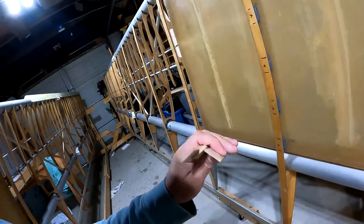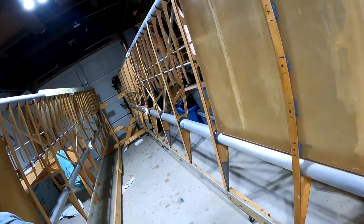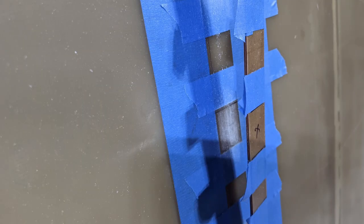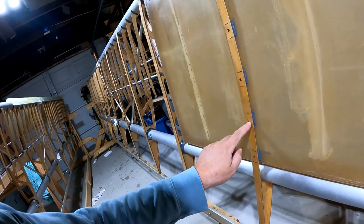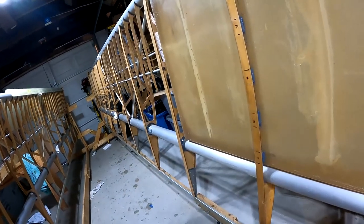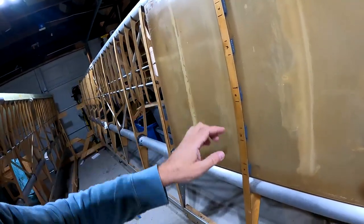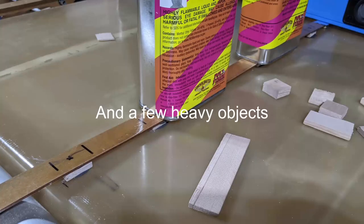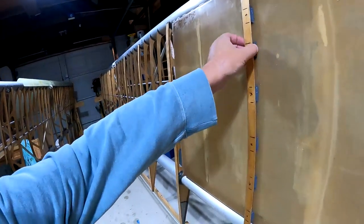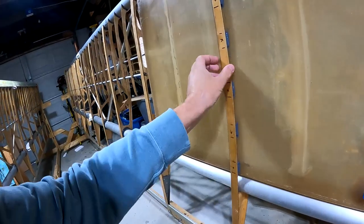I probably had a dozen or more shims in a random pile. Once I found a shim that would work in a given location, I cut its width down and prepped the surface. I had masking tape on here so I could sand the varnish off the upper side of the cap strip and also sand the location on the tank without scratching anything else. Then I pulled that tape, mixed up the HiSeal, bonded everything in place, and used tape to hold it until it cured. Then I came back with more HiSeal and worked it around each of these to seal them in and finish the job. A little bit of acetone will clean off all these marks — mission accomplished.